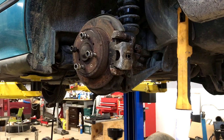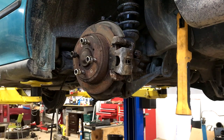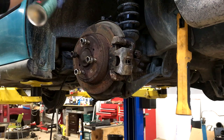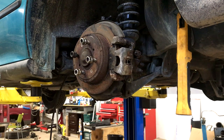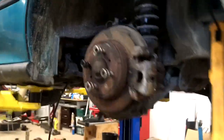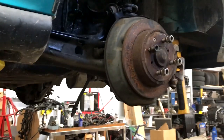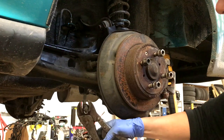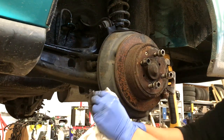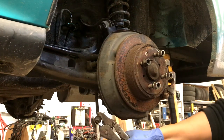I've got my IR gun on the high setting — 17mm, not going anywhere. Now we're left with the brake line. When you get this from the wrecker they usually pinch off that line, so the pinched part has to come off. Move this over — the pinch is right up down here. Remove that pinched section; you can just use a closed-end 10mm wrench. We could have prepped this beforehand to save some time, but it comes loose easily.